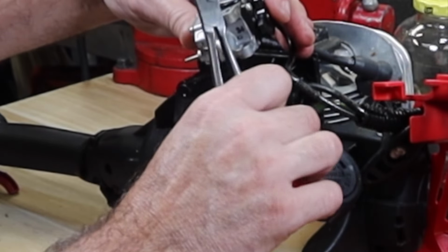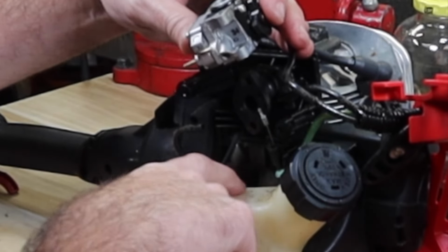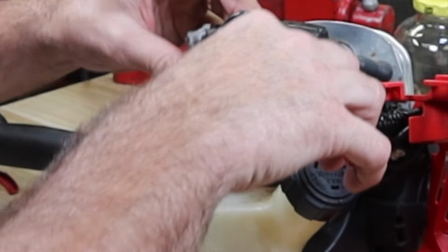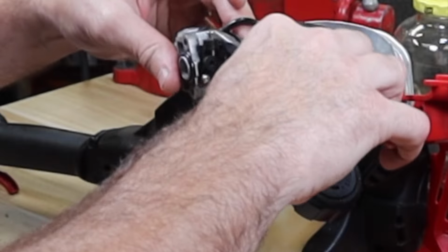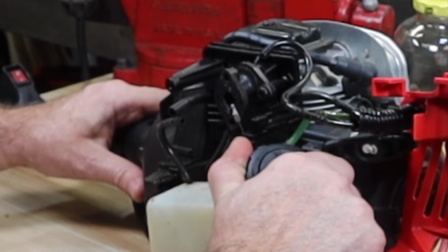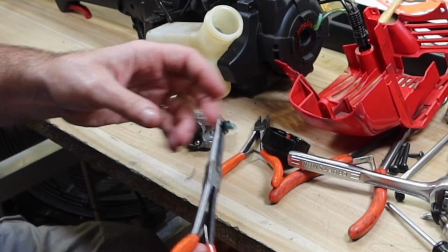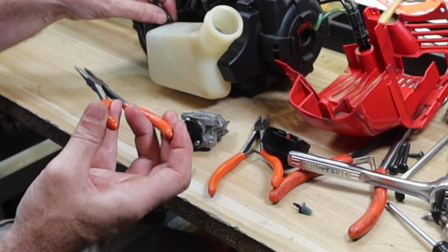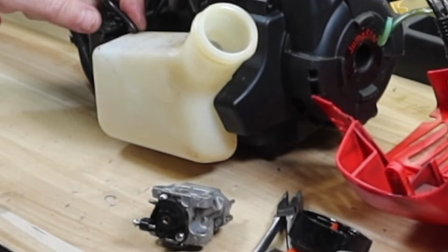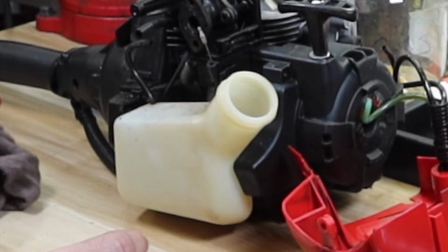One hose there. Looks like this green, I don't know if that's the pickup or the return, but it's broken off right here. And then I've got this hose up on the top. So the one that's got that bend to it goes to the top. So what is the green hose? Is that the filter or is that the return? So a green hose would be return because I can look in there and see. So the green hose is right there and it literally was just the return. So this hose right here is my filter. Goes all the way down to the bottom, which would have meant that any kind of fuel that was circulating would have just spilled out right there.